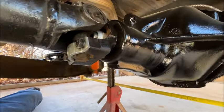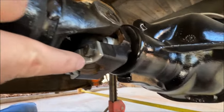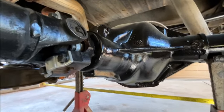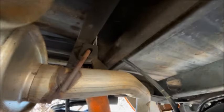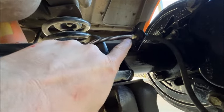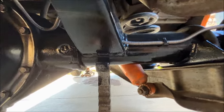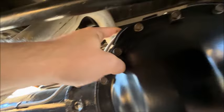These old nine-and-a-half-inch axles use the same U-joint as the HO52 — it's a 1350 — so you won't have to change it. That's where they shorten it on this end. It does use these straps whereas the HO52 had U-bolts — straps aren't ideal, but I'm not looking to do burnouts; I actually use this as a truck. I used the factory nine-and-a-half-inch vent — it goes up above that crossmember. I did have to make a new brake line back here; it's standard 3/16, and the fitting here is 3/8-24. It fits right into the original hose — I actually reused the hose off the salvage car because GM makes good stuff and a lot of replacement aftermarket stuff is not too good. This is three-sixteenths copper-nickel with a stainless steel fitting — I got a kit from Inline Tube; bends really easy and nice.